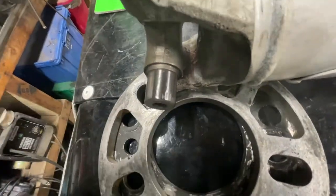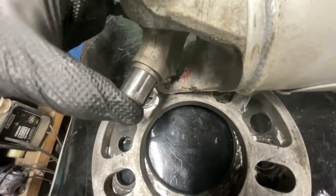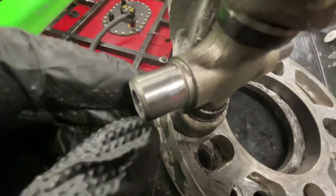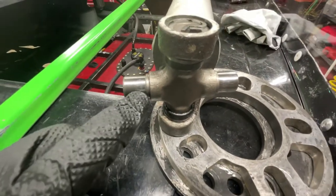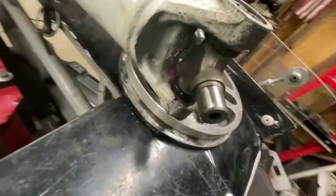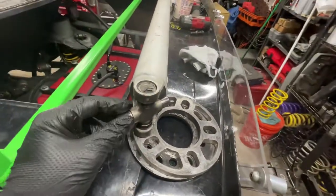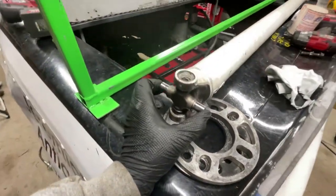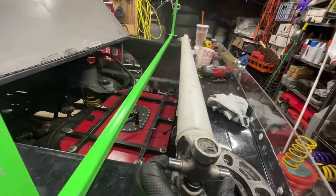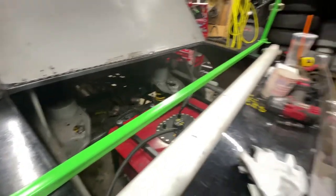You can look at the drive shaft here and you can see that there are really bad marks in the U-joint race. There's some scalloping in the back here — it's hard to see — and there's a little bit around this edge right here too. So I'm wondering if something's gone awry with the angle of the drive shaft, if it's not straight or if it's attached to the rear end improperly.